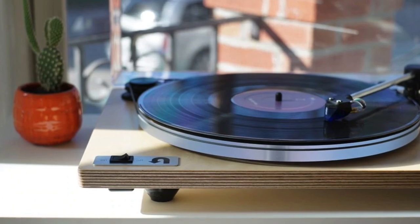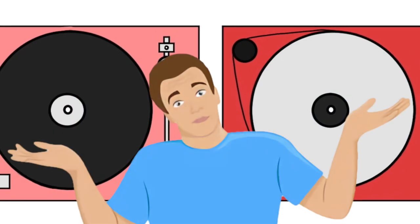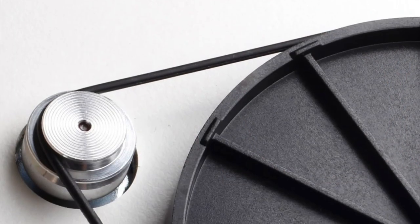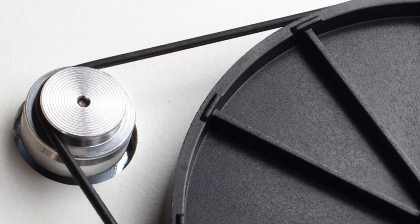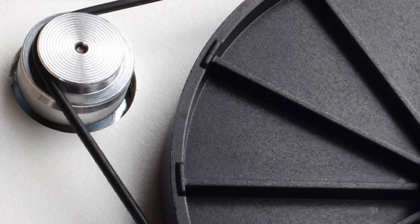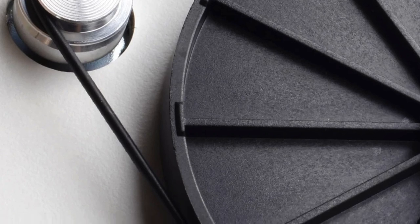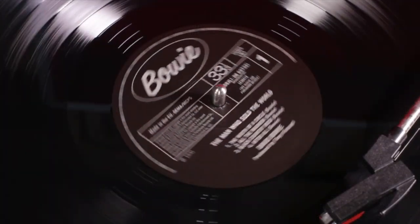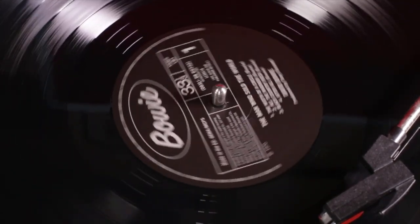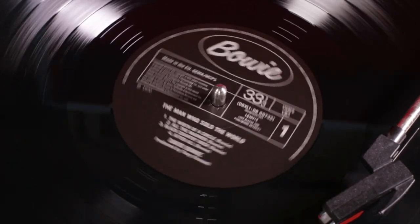So back to the question about which is better — that's actually the wrong question. The question really is: what's the difference, and what does it mean to you and your listening experience? Let's consider the belt drive first. The feature that drew me to it after years of using direct drives is that the motor isn't situated beneath the turntable. It's a simpler design. It's quiet — the motor sits off to the side, and because the platter never comes into contact with it, the chance of unwanted vibrations reaching the stylus is minimized. If there's one thing that will ruin your experience, it's vibrations. So the only connection between the motor and the platter is the belt itself.